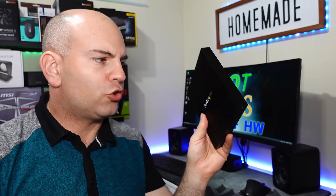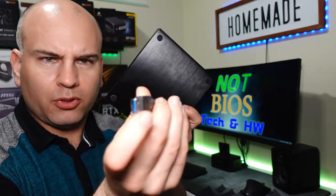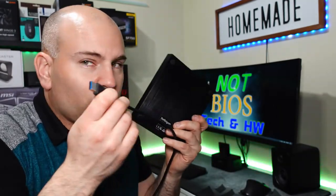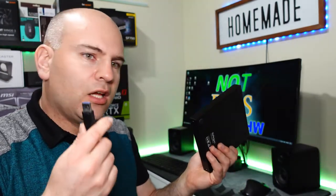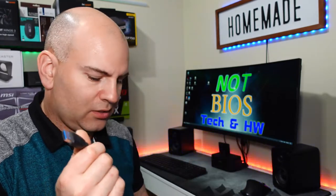So this particular drive caddy enclosure is USB 3.0. How do we know? Well, this blue right here, this is the cable that's included with it, and that's telling me it's 3.0 standard. If you have an older standard, it's not going to run nicely. It might not even run at all. They have a 2.0 enclosure, but honestly, run the fastest one. It has more power throughput, more speed, and it's the way to go nowadays.